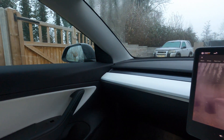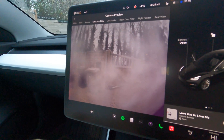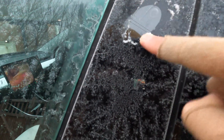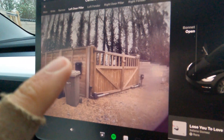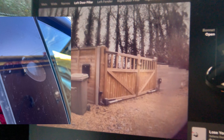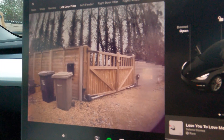The mirrors are looking pretty good on both sides. Let's go look at that left door pillar from outside — you can see it is still frozen and it's not heated around the camera at all. A quick wipe clears it immediately. So there's a little concern about that left door pillar camera not heating up at all — I thought the heating element would have defrosted it. Interestingly, the other day I noticed a tiny bit of condensation inside the camera area, and I'm wondering if that means the heating element has failed.